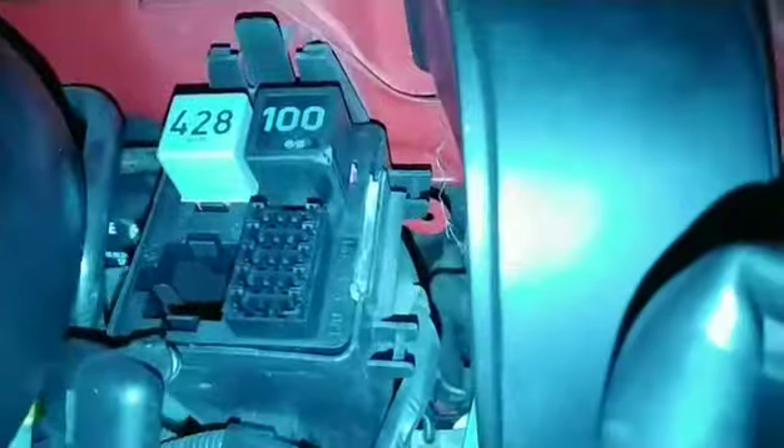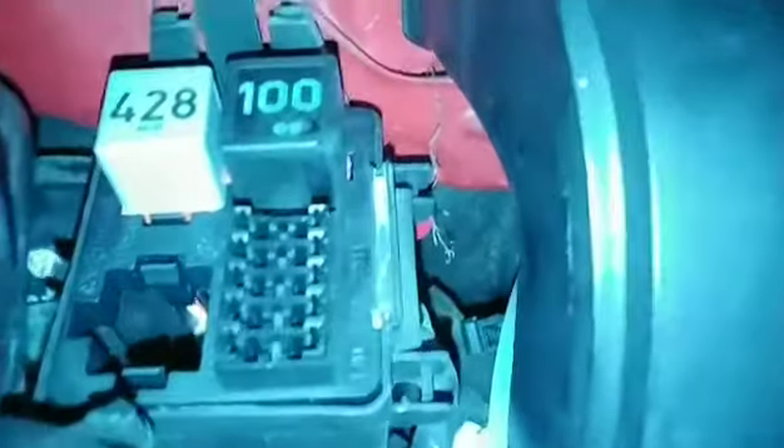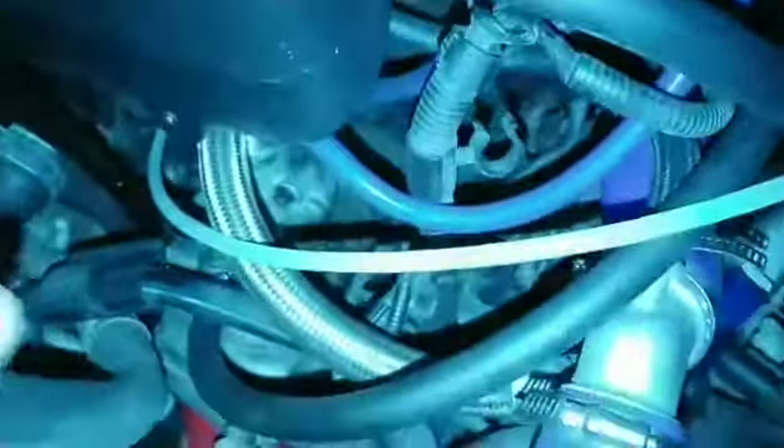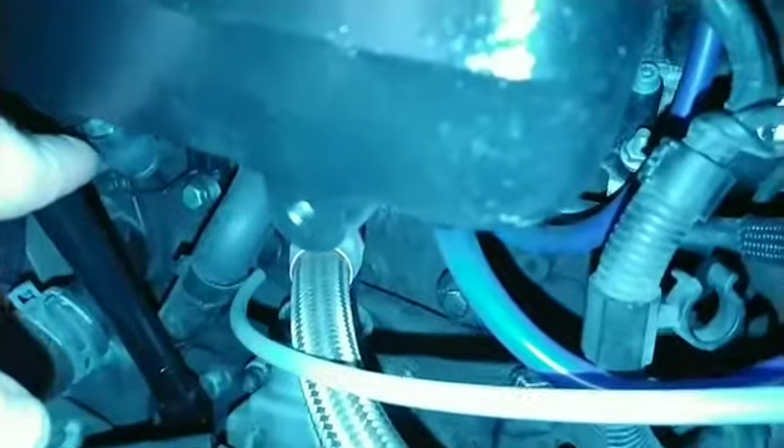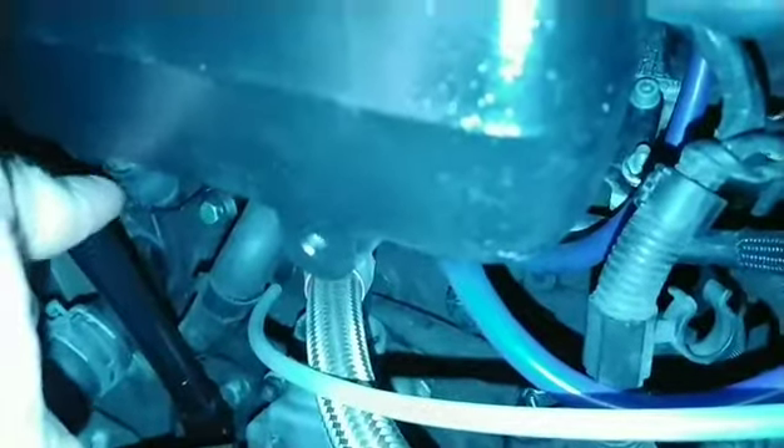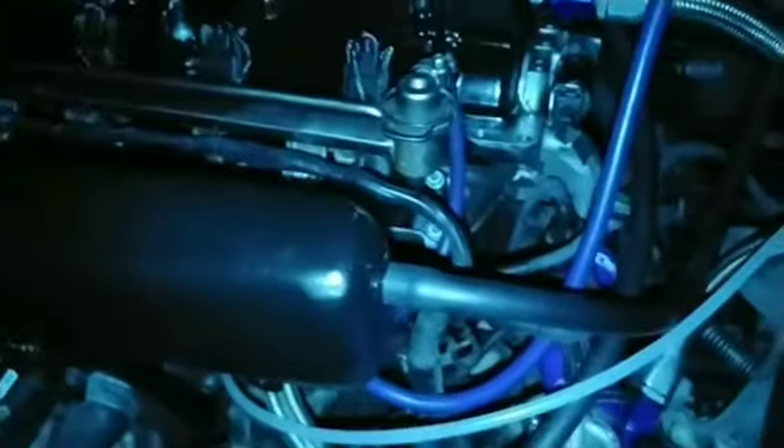It's gonna come out on the other side down here by where the fuse box is — just grab it and fish it out. Pull out what you need, all the way down to the manifold. I suggest running a boost gauge off one of the manifold nipples down here — you can use one of those and block the other one off. You should run it straight to the manifold; you get the best reading.